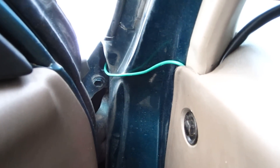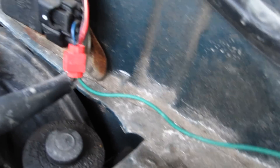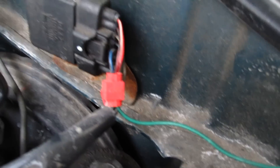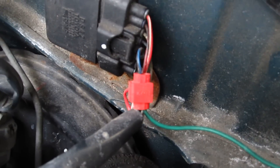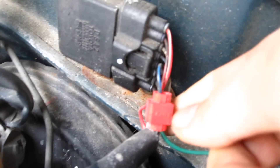Now that I have the other three wires taken care of, I'll get to the fourth one — that's the green wire. What I did was I ran the green wire right through here, through the fender, and I ran it to the ignition module. Every vehicle with fuel injection will have an ignition module. I went online and searched which wire off the ignition module had the actual signal. It turned out for a 97 Tercel it is a black wire with a blue stripe. Make sure you get the right one because you won't get the proper signal without it.